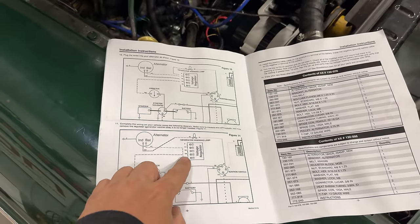Now I can move the old spark plug wires from the old cap over to the new cap and then we'll finish up that wiring. Off of the new Pertronix distributor we have a black wire and a red wire. The black wire goes to the negative side of the coil and the red wire goes to the positive side of the coil — that makes this installation pretty simple. This is the negative terminal of the coil so the other side is the positive. So black will connect right here, red on the other side. Wiring is all now hooked up. You can see the purple terminals on the coil — we have the black wire running to the negative side, the red wire running to the positive side, and then the other wire also connected to the positive side of the coil is our power coming from the ignition switch.